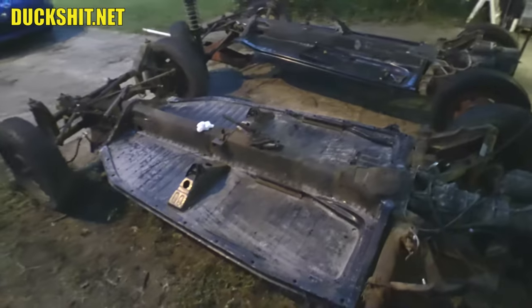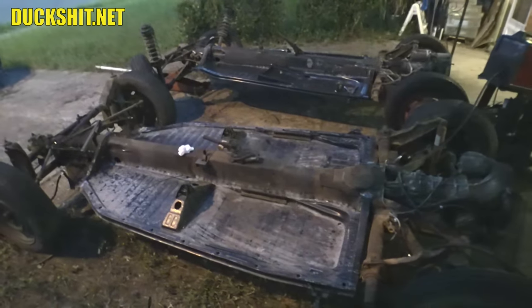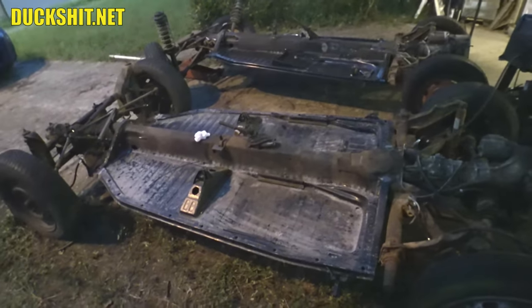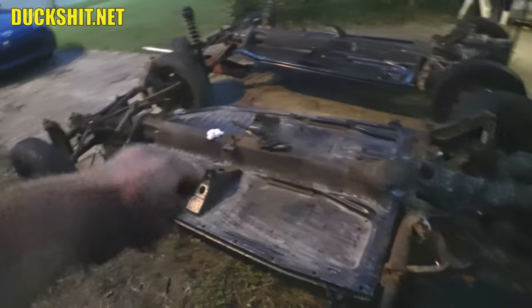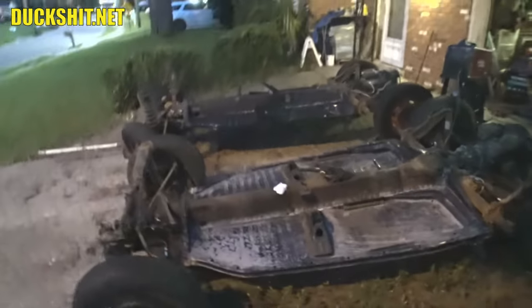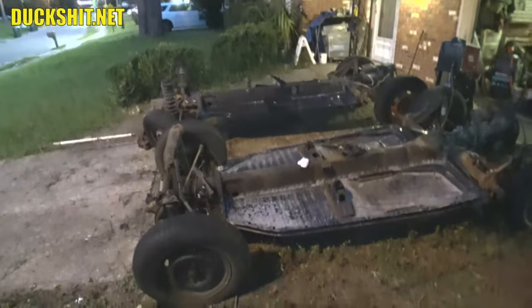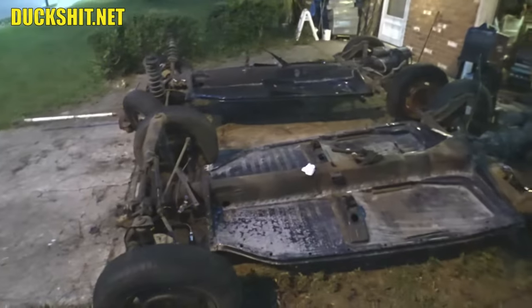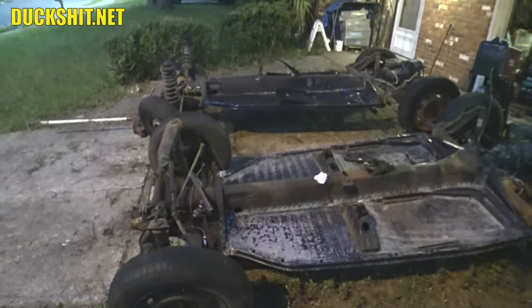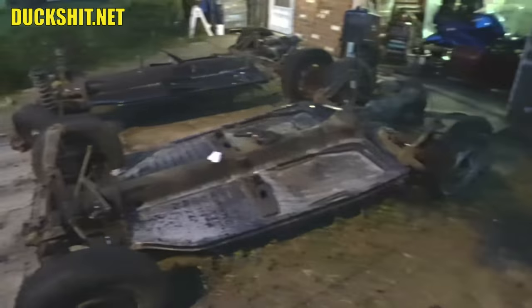So: phosphoric acid, a little paint over that, then we seal everything up with tar seam sealer — the same thing Volkswagen used way back when. You can use a more modern product if you want, but there was nothing wrong with tar. Anytime you pull tar off one of these Volkswagens, there's no rust underneath, so there's no reason to change. We're in a good position. When the sun comes up tomorrow, we'll clean this up, get it prepped for a little paint, and some seam sealer. I only have a couple hours to work in the afternoon — from about 3 to 8 when the sun goes behind the house — because direct sunlight will absolutely fry my fair skin.